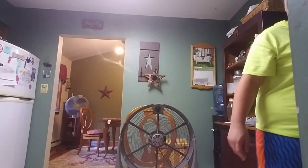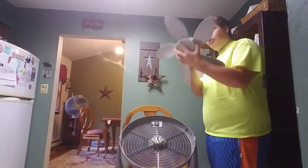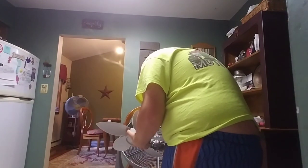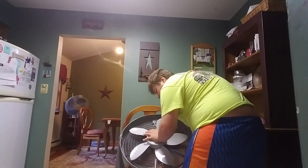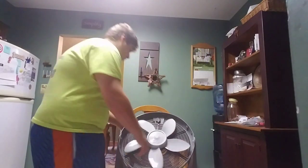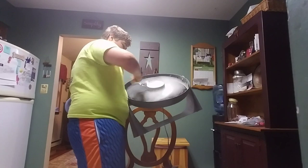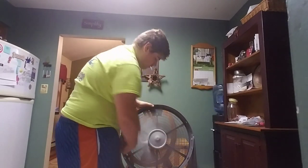So there's a little hack for you guys. Now the final step is to get it all back together. There's a little flat spot on these covers and fan blades. You want to tilt your fan up — this one is pointing upward — and turn your shaft on your motor so it matches your blade. Then you just push it in, and if you need to, kind of tap it in to seat it. Shake it a little bit to get it in more, and now your blade's attached.